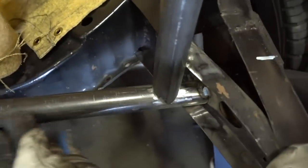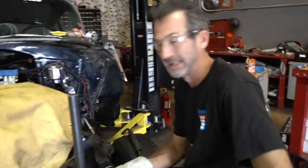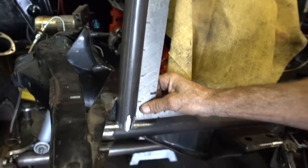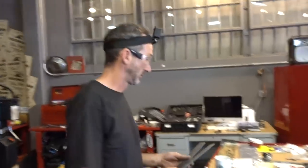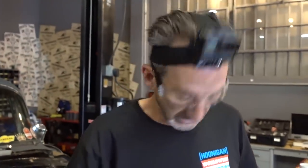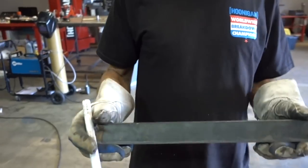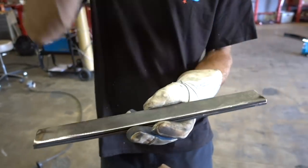So we got these tacked in — the radiator support bottom — and we got our radiator sides just tacked. Now we're trying to get them level both ways with a crooked frame. We're going to get them as close as possible. That guy is straight as an arrow. These are going to be the pieces we weld on here so we can slide the radiator down and bolt to it. We're going to mark the hole from the radiator on here, drill the holes, bolt these to the radiator, then tack-weld it onto here. So it's easily removable. Because I know I've got to make the same holes in both plates, I went ahead and tacked them together with the welder. Now I only have to make my marks on one set and drill right through both of them, then grind them loose and I'll have two exactly the same drilled-hole plates.